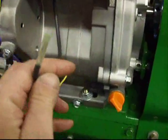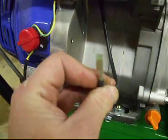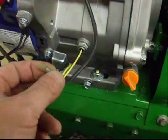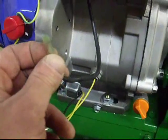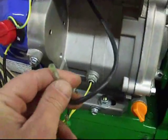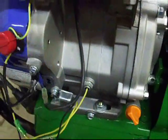We're going to start with trying to hook up our safeties. This is our main wire coming from the new belt cover, from the coil, which everything operates based on this one wire. We have the on-off switch and an oil alert coming out of this new engine — every single thing is tied into this one wire. If we disconnect this one wire, the engine loop for the electrical system is wide open, meaning the engine is stuck in the on position. To shut the engine off, we just touch this wire and short it on the block anywhere, and it will shut the coil off.